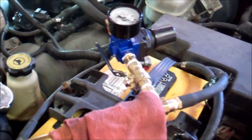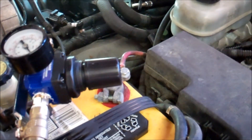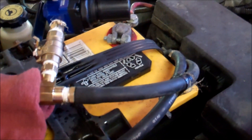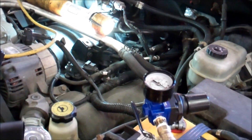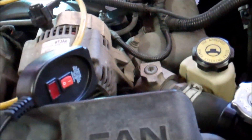I will get that hose, get this updated and show the installation. At least we know our EVAP lines aren't actively leaking, with the exception of going ahead and replacing these hoses and that fuel tank hose. We should be pretty good. And then if we still get the code, we bust out the oscilloscope and multimeter and test the voltage on the O2 sensor. That downstream one doesn't seem too hard, but I'm sure these up here are going to be a bear. Alright, be back soon.